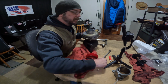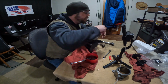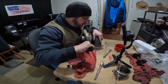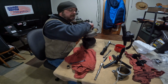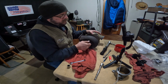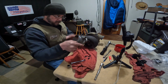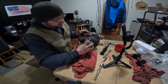Again, hand starting every bolt, threading them down gently. Super awesome. Clearance is great, no issues there. So the last step, without the pedestal O-rings that I'm waiting for, is the exhaust outlet housing. My bus had the exhaust valve, exhaust back pressure valve. This one will not. This one is getting a delete pedestal.